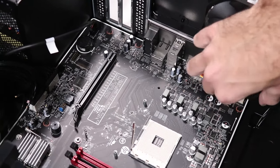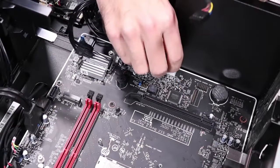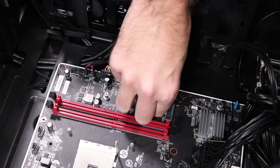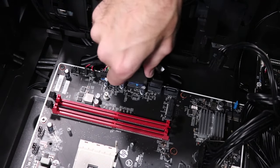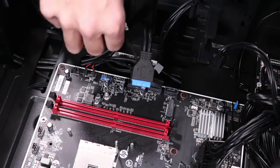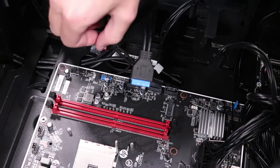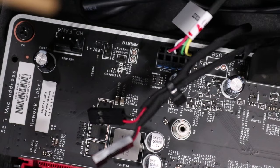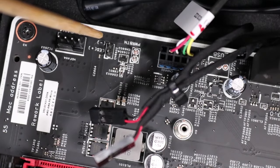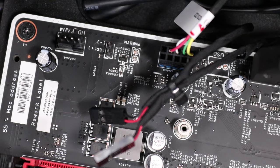Removal: Disconnect the following from the motherboard — 4-pin power connector, rear system fan connector, audio connector, 24-pin power connector, hard drive SATA connector, front I/O USB connector, lighting control module connector, power switch connector, and power LED connector. Note: the power switch connector and power LED connector have a positive and negative side. A positive and negative symbol are silkscreened on the motherboard to help identify how the connector should be inserted. The red cables are positive and should always be closest to the CPU.